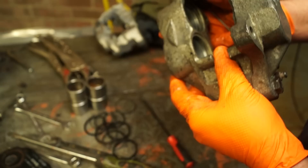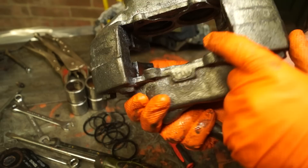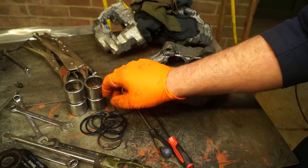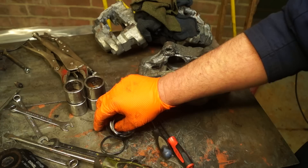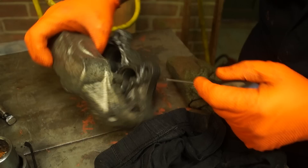What we have is the caliper body in one piece, not in two pieces. Next thing to do is to check what sort of condition the bores are in, if there's any damage or how much corrosion is in there. This caliper is pretty good actually all around - there's no corrosion at all. So this is serviceable - no scratches on the inside or pitting anywhere. Seals are now unserviceable. I would keep the seal retainers if they're in good condition, just in case.